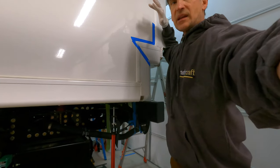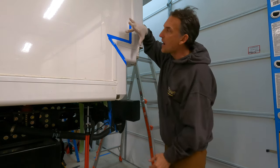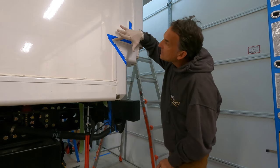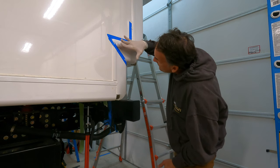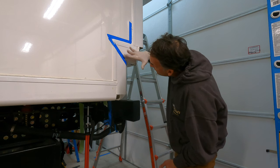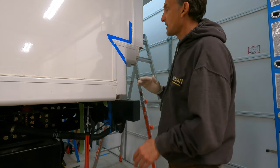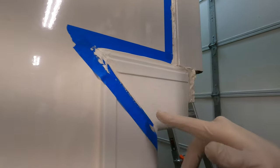There's a big wall of caulk — I should call it sealant — that built up when I pulled off the tape. I'm going to come in carefully, plant my arm on the camper wall to stabilize it, get a stable stance with my feet in a wide pattern so I'm not bouncing my hand. Very carefully pushing this wall of sealant towards the tape that's here — this is a 45-degree butt seam between two extrusions, so I want to push it into that seam to make sure it's well sealed.